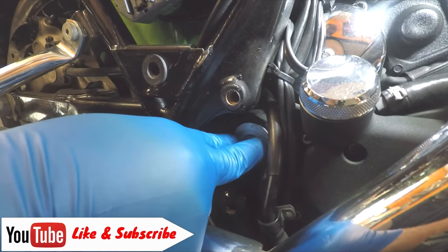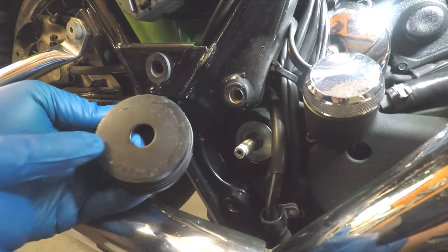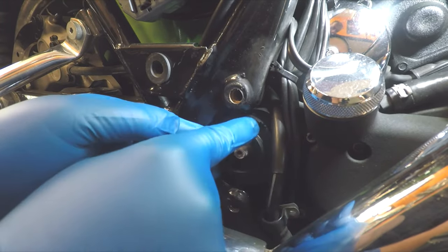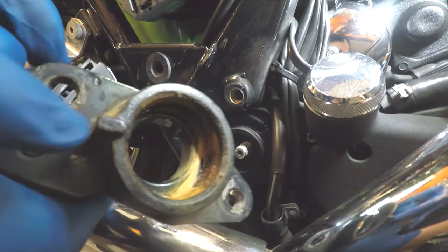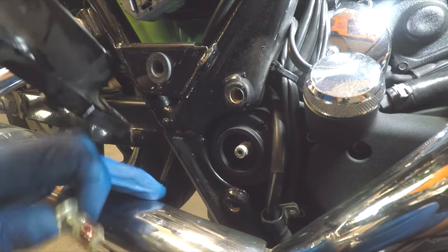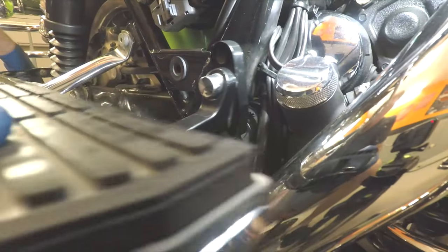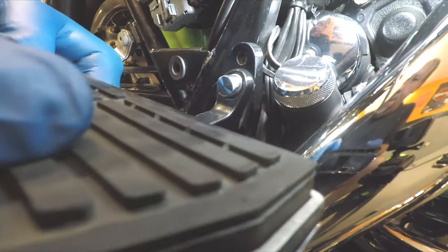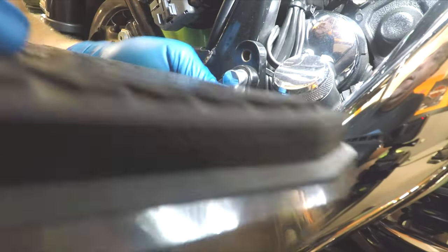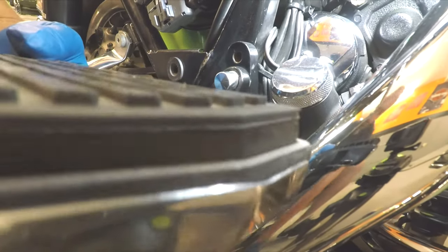I already had the spacer in there. Now we're going to put the bushing in — the flat spot with the metal, almost looks like a washer, goes in first; the deep side faces outward. I'm just going to put it in there. That little tab is going to line up with the tab right here. All these bolts you want to put Loctite on. To put this back in — since I did not take the exhaust off — I'm going to put the bolt into the bottom first. Alright, now I'm going to line up that slot with the tab on the assembly here.